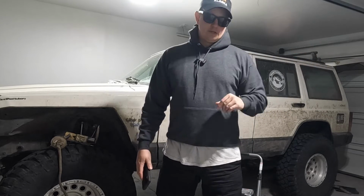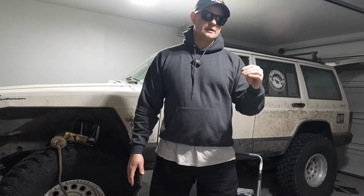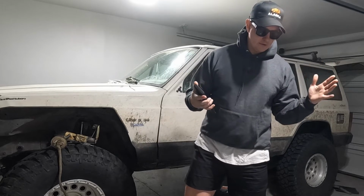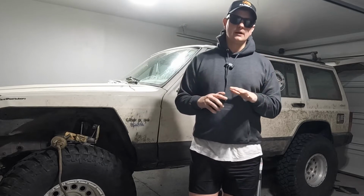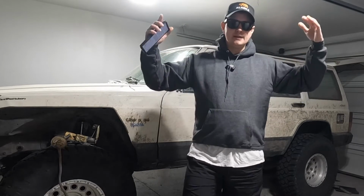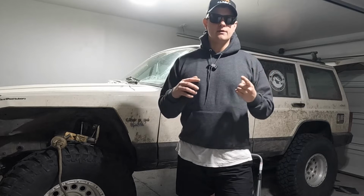So 1.5 to 2 inch lift kits. Make sure that the lift kit you're buying comes with rear geometry correction. Now this category, the medium category, really allows for the maximum size tire that a Subaru can comfortably run regardless of lift amount. So you kind of run into a position with Subarus where you run out of gearing and power and torque with a Subaru.